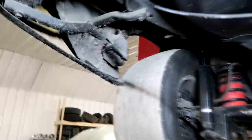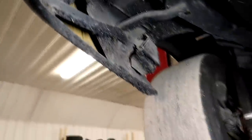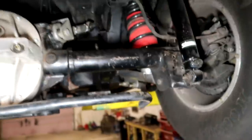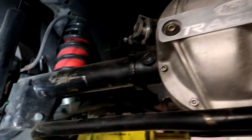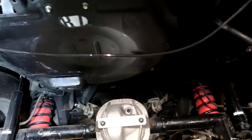There's a vacuum line hanging back here — I'm not sure if it's for a nitrous system or something, but all that stuff probably has to go. It still has factory fuel lines all through it, the factory fuel filter, and all the hard brake lines are factory. If I don't have to mess with the brake lines too much, I'd like to just utilize what's here. I ripped out the gas tank today, so there's no gas tank in it. This car is going to run a fuel cell and possibly an intercooler tank, so I've got to figure out where to mount that stuff and how big of a tank I want — and still fit it all in the trunk.